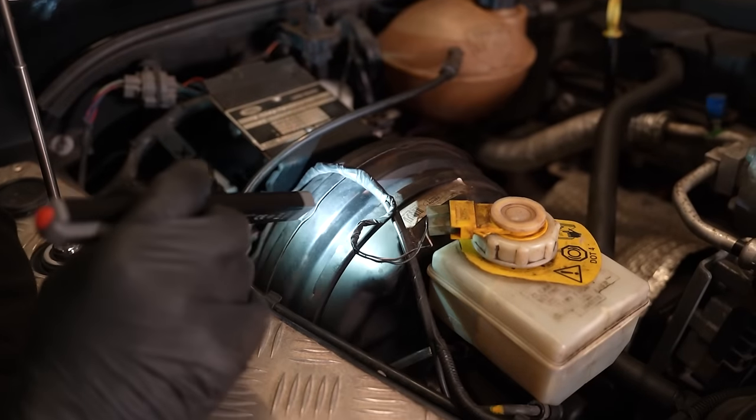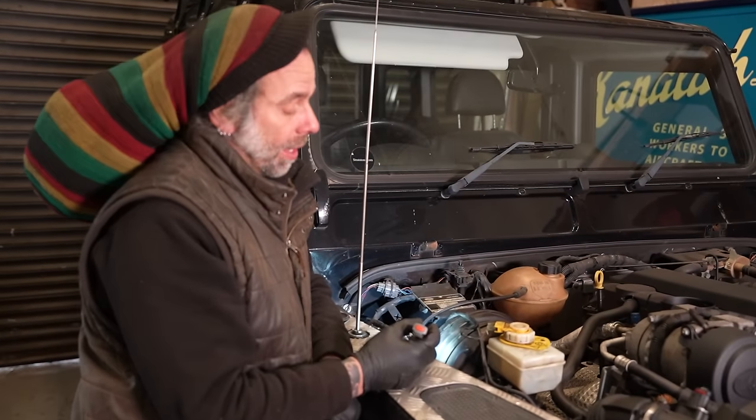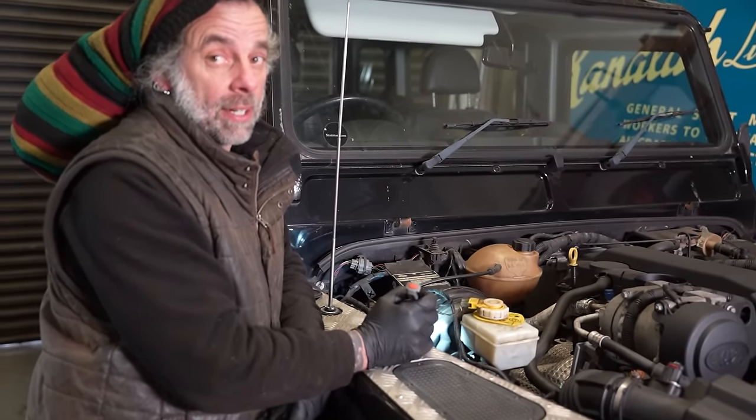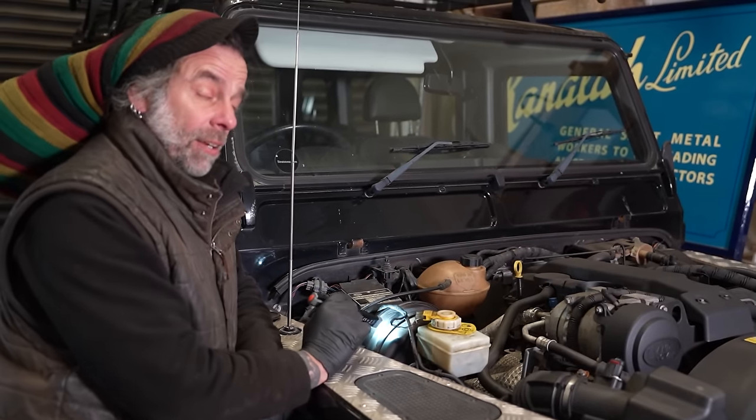But now it's all making it nice and easy for us, isn't it? So okay, master cylinder off first. Master cylinder off, then we'll see if our servo's got any brake fluid in it. Get that off as well, get it out of the way. It hasn't got any brake fluid in it. We're probably still going to have to get it out of the way to access this